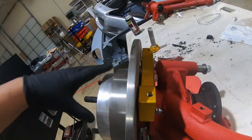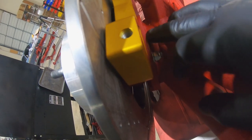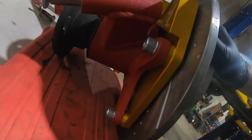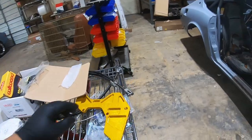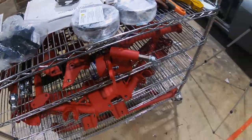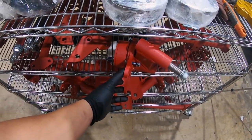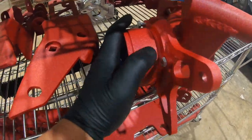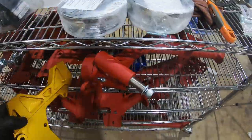We're already in much better shape. I've got proper rotor clearance and the caliper clearance looks good. My only complaint so far is this mounting pattern here needs to be reworked for the factory splash shield and dust shield — this pattern is a little bit off. I was able to get one of the bolts in for the Techno Toy bracket. We can't always expect competing aftermarket companies to have parts that fit perfectly, but these are modeled after the factory control arm and I've already checked — it fits on the factory control arm perfectly. It's just a little bit off on the Apex arm, but it's still better than the first set I got — on that one I could only get the two caliper brackets bolted up and none of these lined up.